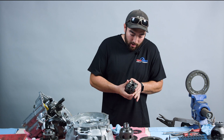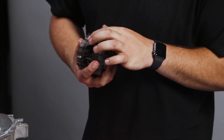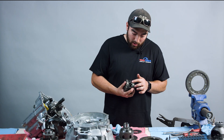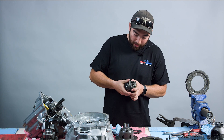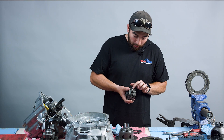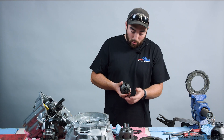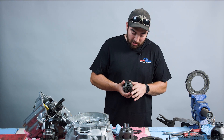A one-and-a-half way means you have your acceleration ramp, but then there's also another ramp for decel. It's going to allow some lockup — not quite as efficient, just partial lockup, it won't work quite as well — but it will give you some stability under braking. A true two-way means you have the same ramp profile for acceleration and deceleration, so under really heavy braking or any kind of no load on the gas, it's really going to lock these up and give you a lot of stability.